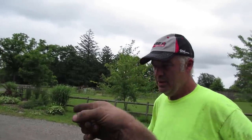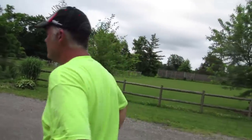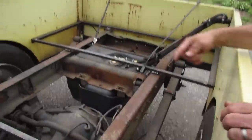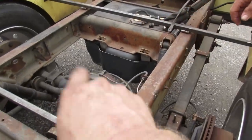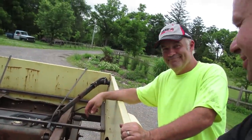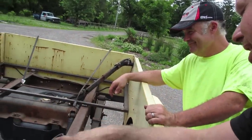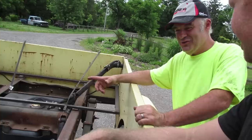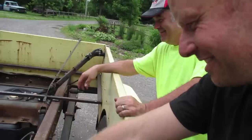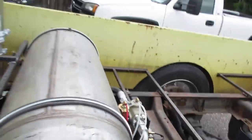Okay. And you've got 476 rear end? 470. I wrote it down so I wouldn't forget. 475. 475. It could be 476. I was just counting the... Oh, okay. So it's a 475 rear end, and we figured top speed's about 70 K an hour. So we need to change that. So I think a 373 even would actually be nice. Tires, I thought that would make a difference. Yeah, but it's not. So let's change the governor, and then we'll take it for a little drive.